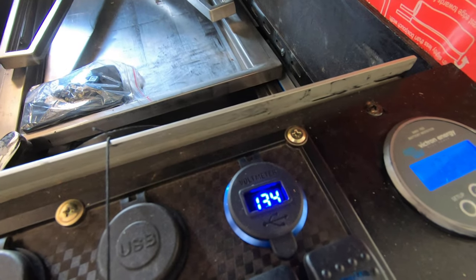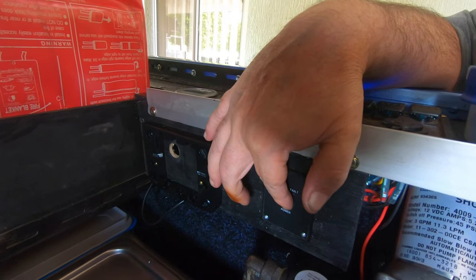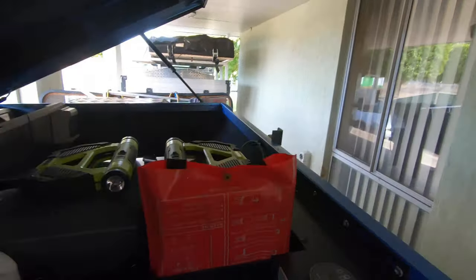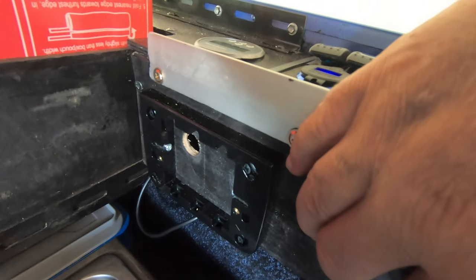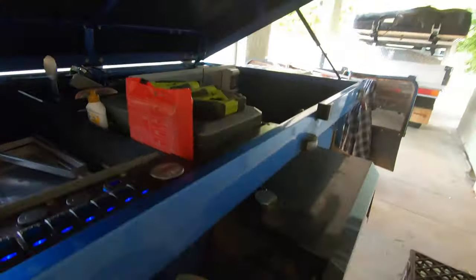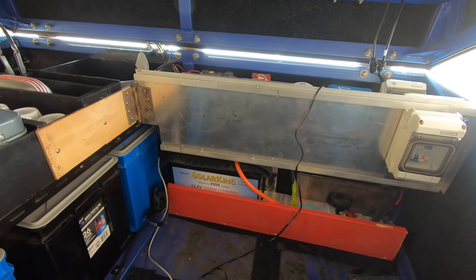The thing with lithiums is the volts don't drop much, which is why you really need to go off your consumed amps. All my wife's got to do to get power - you hear that? - the inverter's live. When we eventually get this power point put in she'll be able to plug in right here and power what she wants. And the inverter's now off again. It is a little bit of a reach in there to turn those switches to the on position, but remember: at the start of a trip, once they're on, they're on - unless I blow a main fuse.